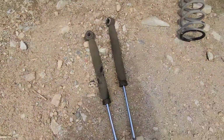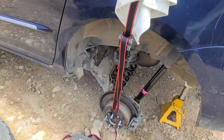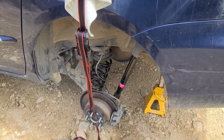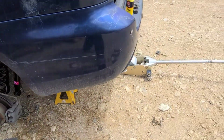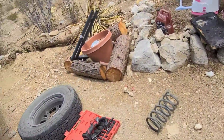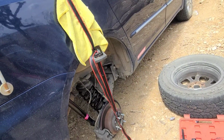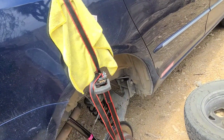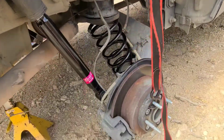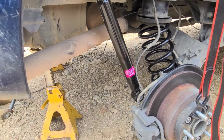And here's the blown out shock absorbers. The Journeys off-road kit always adds like an extra hour to the fix-it jobs. You know, the front ends, I've had to swap out the drive axle a few times. The boot split and it seized on me once, and that's because of the angle of the axle to the wheels after the lift kit was done. But anyway, time to replace the back end.